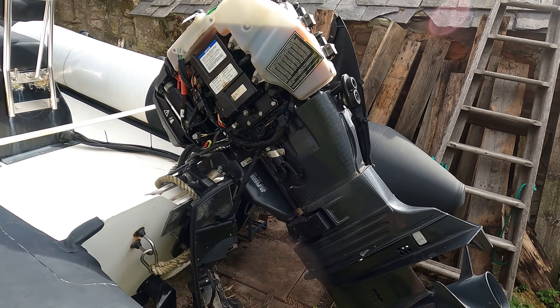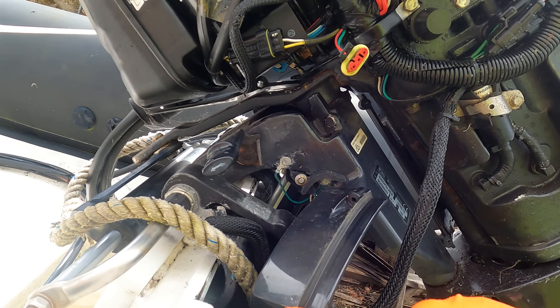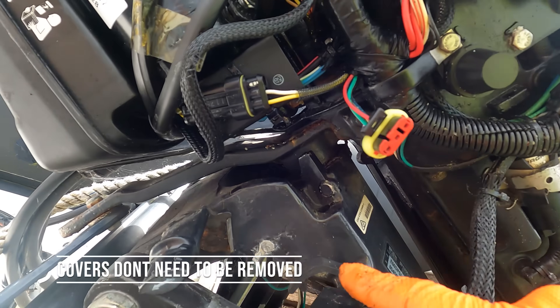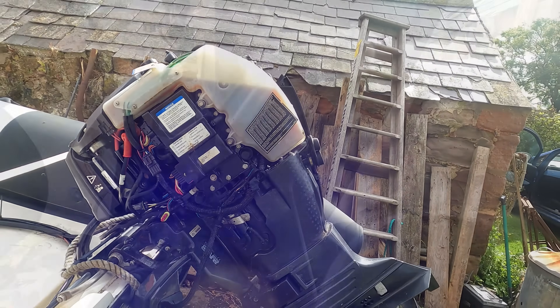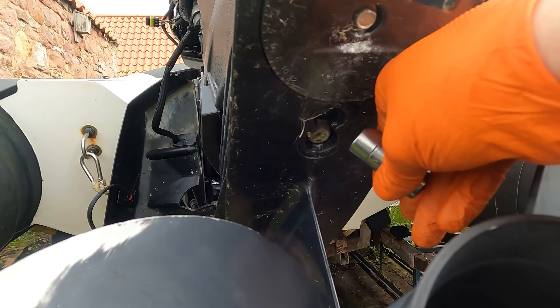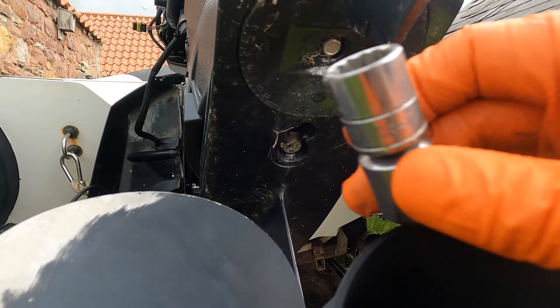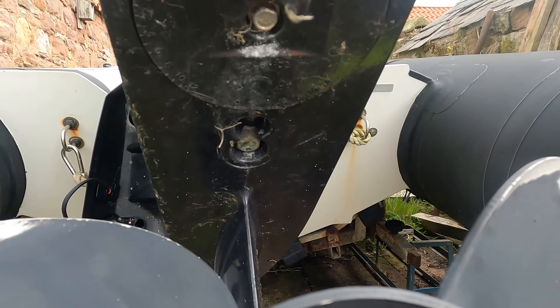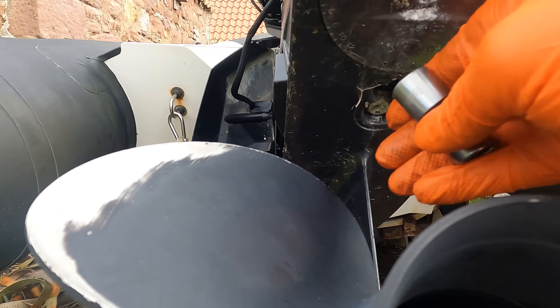Just for reference, this is on the left-hand side of the engine at the front. Remove the side cover — it just makes life easier and you can get in under here. For this main bolt under here you've got an imperial 5/8. I've had problems with these being really stiff so I've got a long breaker bar on it, but this one isn't too bad — it came off straight away.